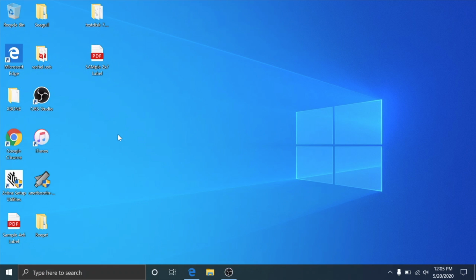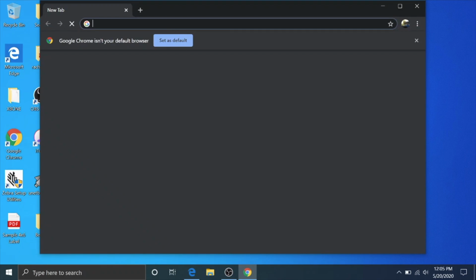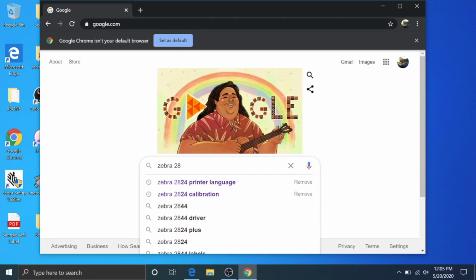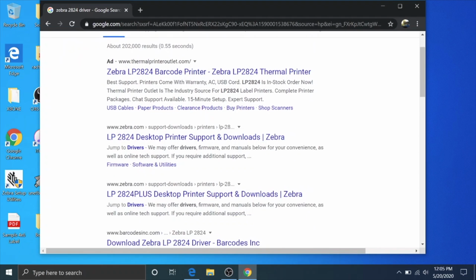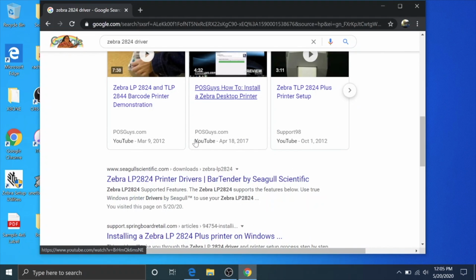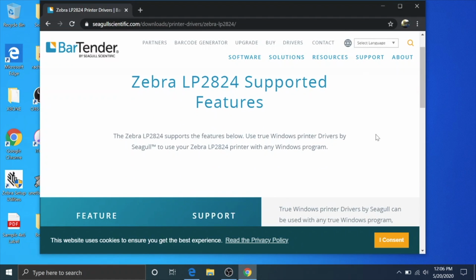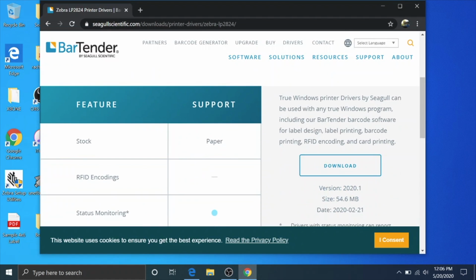On your Windows computer, you're going to want to open up your favorite browser, Google Chrome or Microsoft Edge or Firefox, whatever. You're going to go to Google or your favorite search engine and type in Zebra LP2824 driver, and you're going to want to go to Seagull. They make a great driver right here. And I will put a link to this driver in the description for ease, because sometimes some people have trouble finding it. So we're gonna hit download right here.